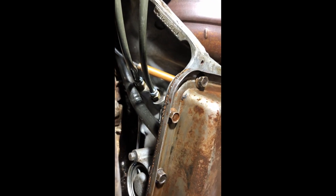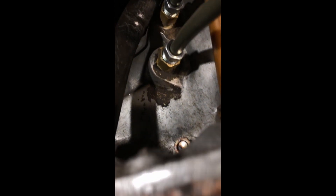I gotta jack it up and see what's going on. I switched to my phone to take video down underneath the car. Under the car here at the transmission — I can't tell for sure, but I think it's the kickdown linkage that's leaking.